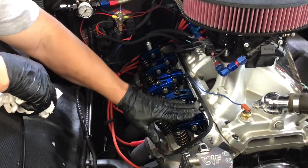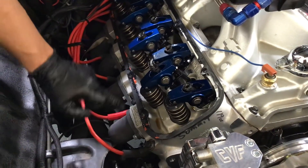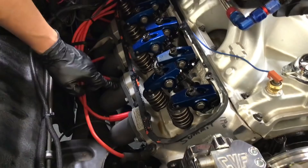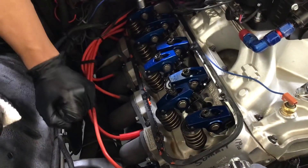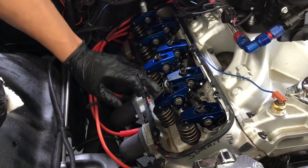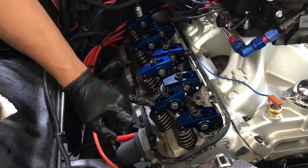So this is your intake — as you can see, it goes on your intake side. This is your exhaust — as you can see, this is coming out from your exhaust. The simplest method is just remember: exhaust opening, set your intake. Intake closing, set your exhaust.